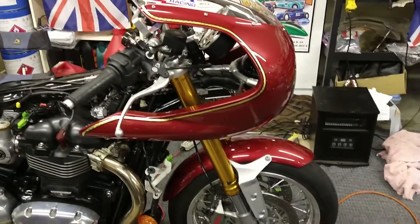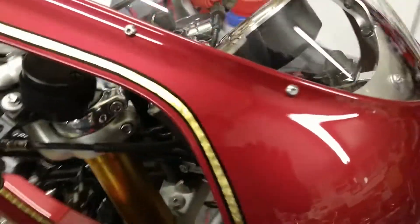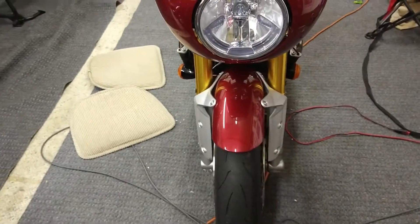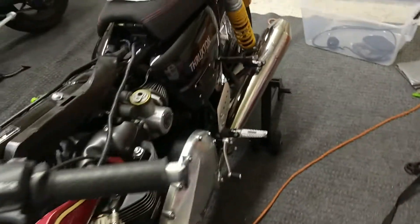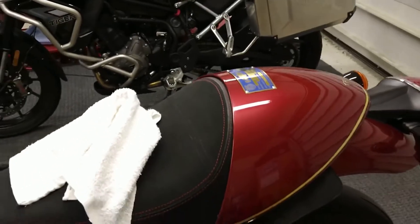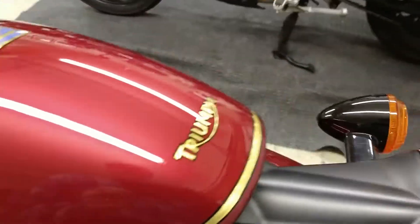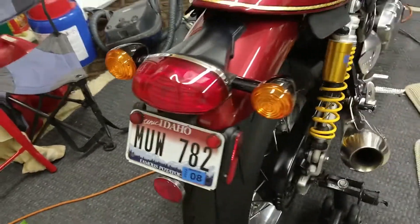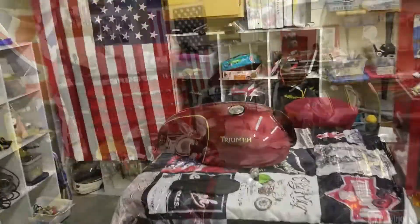So for example, in this paint job, how many coats of paint is there? There are three coats of base and then three coats of the mid, and then there are three coats of clear on the parts that have no gold leaf, and six coats of clear on the parts that do. Some of the parts actually got stripped down to repair the damaged areas, but some of them just feathered out around the dents, removed the dents, and then reprimed that area. So yes, did paint over some of the existing paint job, but not all pieces.